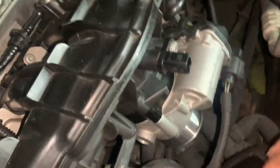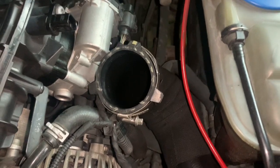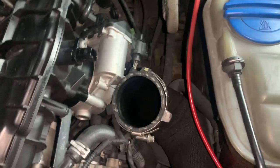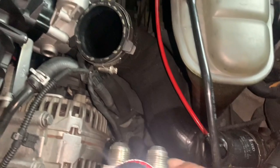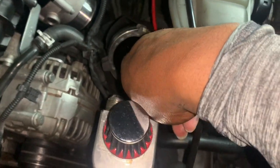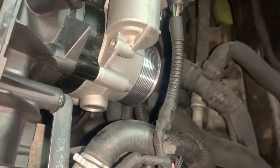I'm going to go ahead and loosen the other side as well just to get this part out of the way. A lot of times you want to go that extra mile and remove parts so they won't be in the way or cause a conflict. A lot of this plastic could have been on here a long time and be brittle. I'll unplug the water methanol line and remove this entire pipe instead of just tucking one end away so I won't damage it. The charge pipe from the intercooler to the throttle body is now out of the way.